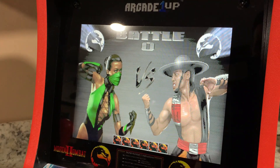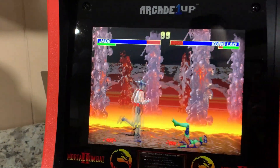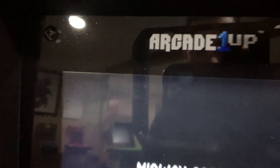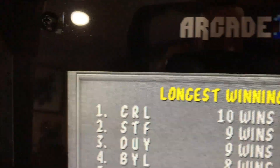Hold up just one second — just when you thought everything was okay. I'm sitting here recording this video and I had to add this caveat: when I took all that off the Mortal Kombat countercade and put it back in the stock configuration, it messed my monitor up somehow. I think it maybe just adjusted some brightness or something, but when you put your stock PCB back, you lose the ability to control or adjust anything. I don't know if this is permanent damage or not, but just be aware — this could be a one-way deal. Don't think you can just put this on and then go right back to stock configuration with no issues. Your mileage may vary.